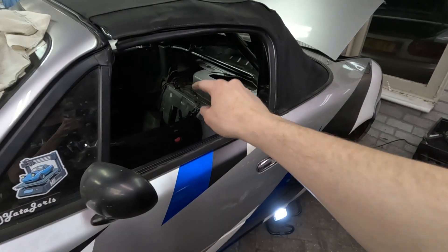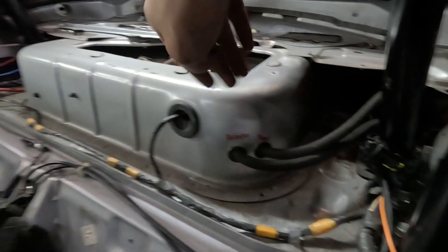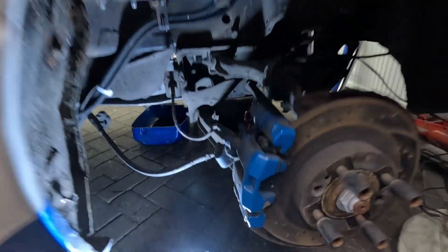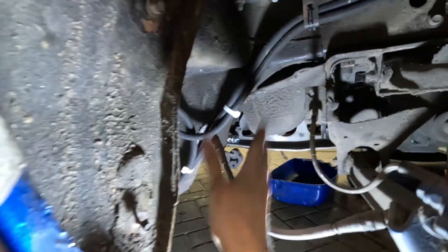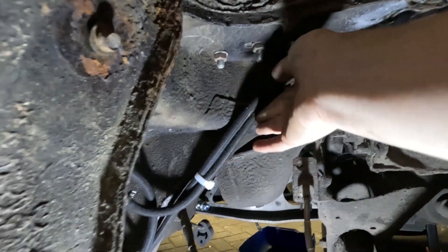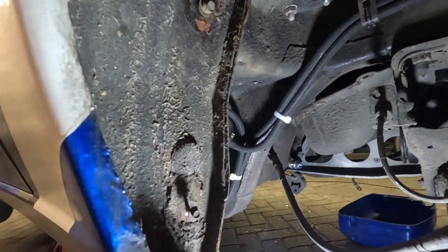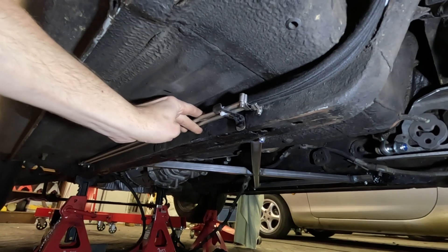So we're moving all of the fuel lines to the driver side of the car. This is a left-hand drive of course, and you just saw us make the lines go down to the driver side so it doesn't cross over to the other side past the exhaust. In the meantime we've also fitted the original filter again. We used some Riv-nuts to mount it right here. Normally there's a plastic panel that goes over all of this, so the fuel lines and mounts are covered. We've tucked it up so it doesn't come near anything.